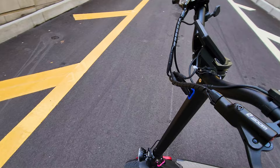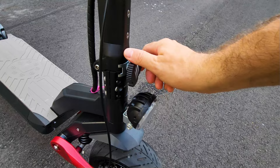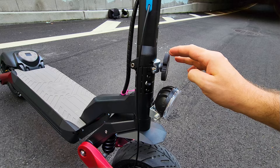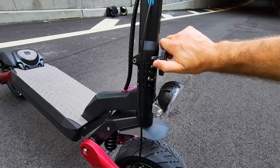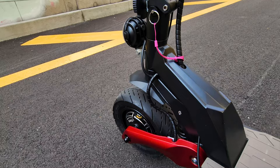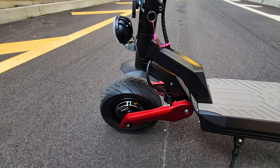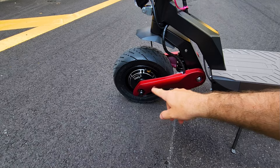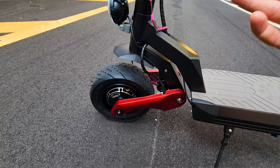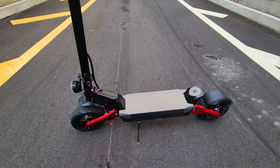Besides the brakes, it's pretty much the same frame. I feel like there's more precision and better CNC construction here at this latch when I unscrew it — it's much smoother and much easier compared to the previous pre-production version. After several days of riding I noticed it's much more solid, no movement in the bottom. Going fast and aggressively after a week of reviewing the previous model, things get loose. Always make sure you have all joints tight and lock nut applied. As maintenance for any electric scooter, every one to two months you should double check the frame, all the nuts and bolts. But this, out of the box, feels sturdier.